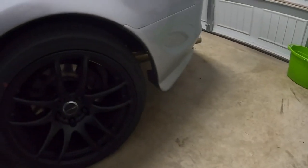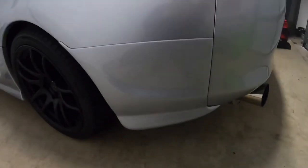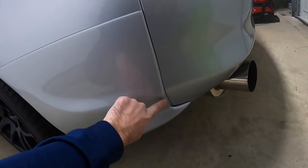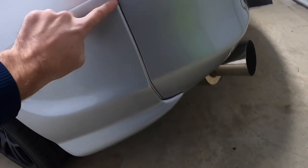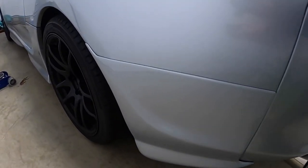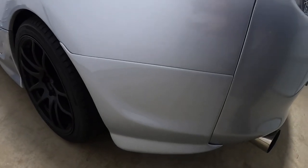Here it is — it's all put on, tape is stuck to the car, and there's no going back. I think it looks great. The paint matches perfectly, it lines up nice, and I got the bracket underneath to fit and line up. I'd recommend doing two layers of tape right here — one on top of the other — just to make it a little thicker, because the gap here is a little bigger than the rest of it. Just for this two or three inch section, double up the tape so it's a little thicker. Let me know what you guys think — do you like the JDM body kit or do you prefer the US spec stock body? I definitely prefer the JDM, but I'd love to hear your thoughts. Thanks for watching!